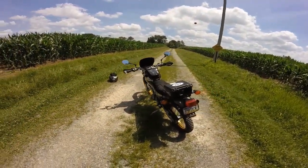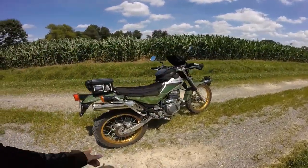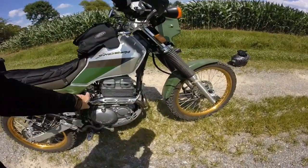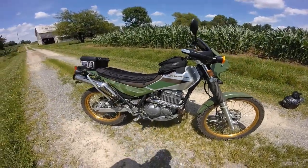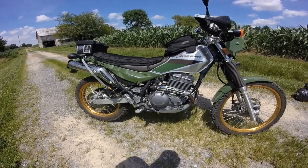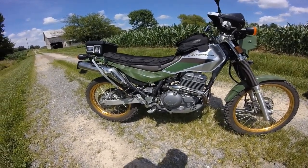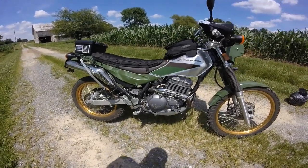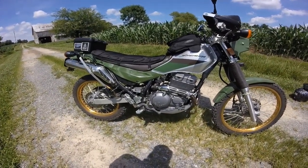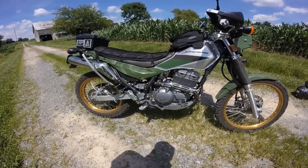Got this back in December. I did quite a bit of work to it — the usual carburetor rebuild, which I did with an All-Balls kit. The dealer did all the install and it wasn't a bad price. It was cleaned, new kit, and adjusted quite a bit to get it running better. If you know anything about these machines, they came in under the federal EPA and they're just running super lean and really difficult to run. So I did a lot of adjustments at the dealership.